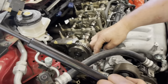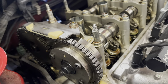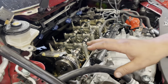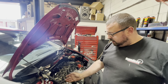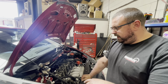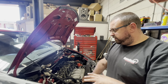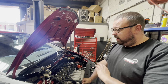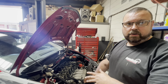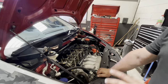Okay, chain's back on. Yeah so the main chain is back on. To be fair I didn't want to go into a little bit more depth with that but unfortunately we're all very busy and people coming in and out so we didn't quite get a chance to do that. But yeah, we've put the new timing chain on, new guides, new tensioner, torqued everything to spec, put the side casing back on, bottom pulley back on, coolant line, the VVT centre, basically pretty much built everything back up. Jensen's at the point now where he's going to get the engine mount back in and we're going to get the new set of plugs in there which Modfix asked us to put in. At that point we're going to leave the engine dry overnight — simply because we've had a lot of casings off, the sump off, the side casing off, and I want the sealer fully cured so it doesn't have any oil leaks. Some people put it on and fire it straight up but generally I like to leave it overnight if possible. Modfix has taken the courtesy car so we can leave it overnight and put some oil in it in the morning.